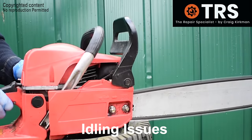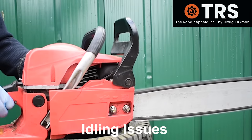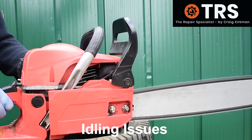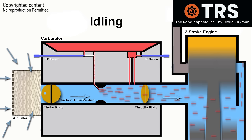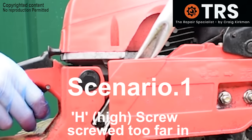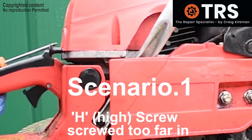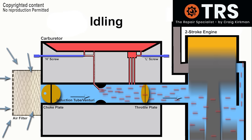We've got another unfavourable situation here where the chainsaw makes that bog sound before it revs up, but this time it's also having trouble idling. If it wasn't for the fact that I keep pulsating on the throttle trigger, the engine would definitely die. The flag here is the chainsaw's trouble idling in combination with that bog sound each time we press the throttle trigger to keep the engine going. Unlike the situation where the H screw was screwed too far in, making the fuel mixture too lean and causing bog-down, this problem is very much the idling settings — and a large part of that is down to the L screw, or low screw, which controls settings for low revs.